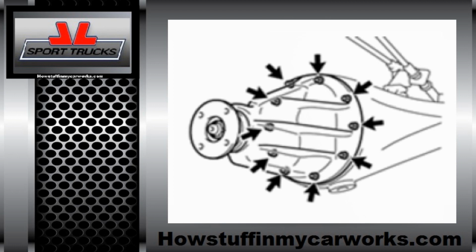Next, hold the carrier with one hand while you remove the last nut, that way it won't fall on you. Detach the differential carrier from the axle housing and remove it from the vehicle. If it feels like it's stuck and it doesn't want to separate, just use a pry bar or a screwdriver. Once you have removed the differential carrier from the truck, inspect the gears and bearings for damage.